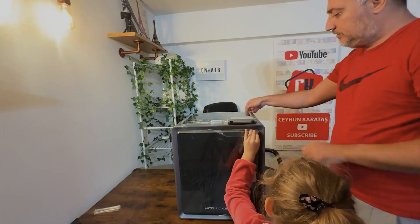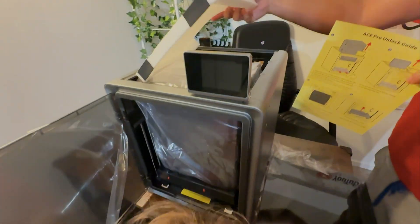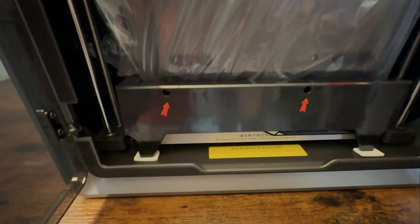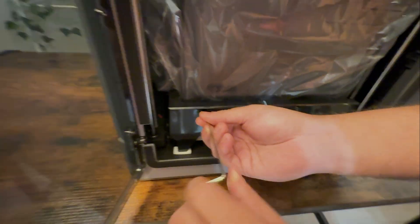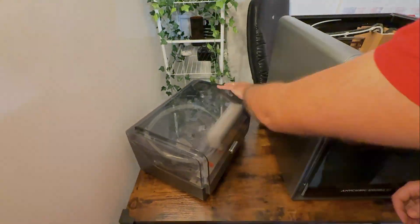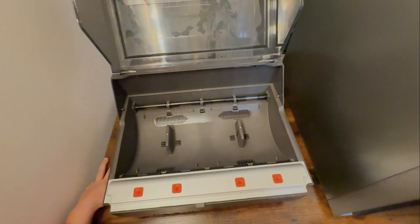During this process, I completely remove the top cover. The AMS Pro module is built into the printer — I need to remove this cover to access it. I also remove the foam protecting the AMS. The AMS Pro module is secured to the printer during transport. Using the Allen key provided in the box, unscrew the screws indicated by the red arrows and remove the AMS module from the printer. After removing these two screws, remove the AMS module and store it separately. Remove the bags and open the lid — inside you will find the hoses needed for installing the AMS module and the test filament.